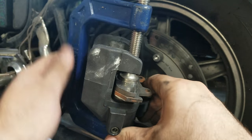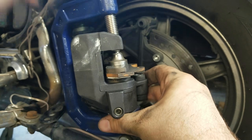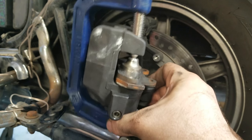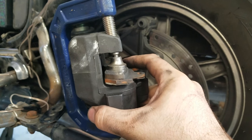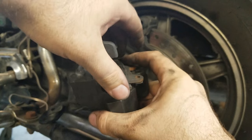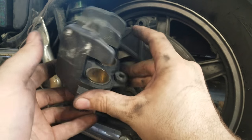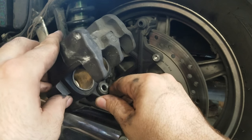Now that we've got that, you can see we've got our C-clamp here ready to push our pistons back in. I'm using the old brake pad to squeeze them down. I'm going to start turning and push our pistons back — want to bottom them out. You don't have to use a C-clamp if you've got some big channel locks or enough strength to push them down yourself. I just use a C-clamp because I want to. Alright, we got those pushed down — easy as that. I may take some brake cleaner, spray in here, and clean it up a little bit, then I'll go clean up the little hardware and take the pins to the wire brush to get them ready to put back together.